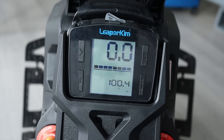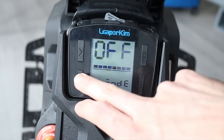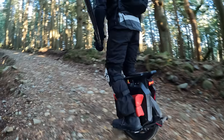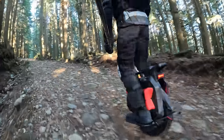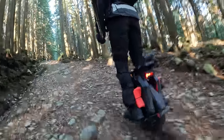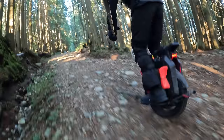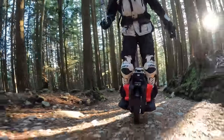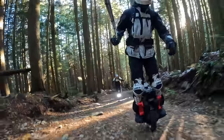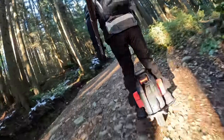There's also a low battery mode which I'll talk about more in the features section. If the wheel would overcharge — say you charge to 100% and go downhill right away — it will tilt you back because braking is charging the battery and you need to protect the batteries there as well. There's also a tilt back and beep when overheating the wheel, though this didn't happen to me as I didn't ride it hard enough, and it was wintertime here in Vancouver. So there are quite a lot of alarms and safety protections here; the thing I miss most is progressive tilt back.